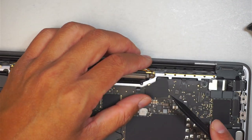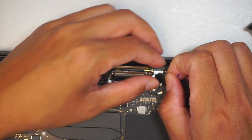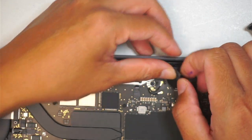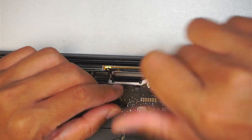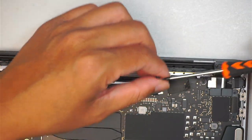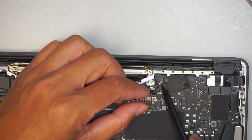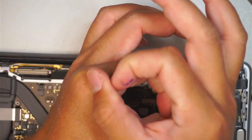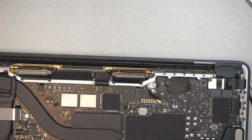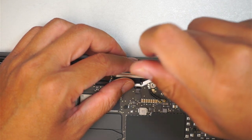The Wi-Fi is hidden right underneath here, so peel off that little plastic cover. Use a T5 to remove that screw. Then use the pointy end of the plastic prying tool to pry open the Wi-Fi cable connector — it's two little circles sitting on top of each other; just lift it up to remove. Once done, come back with the Pentalobe P2 and remove six screws to free the Wi-Fi antenna.